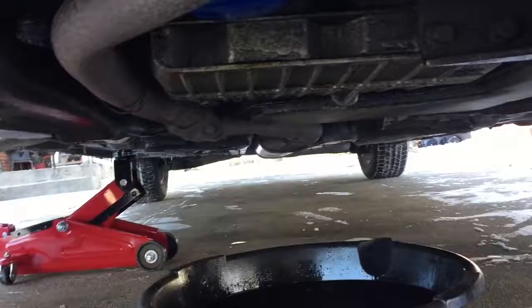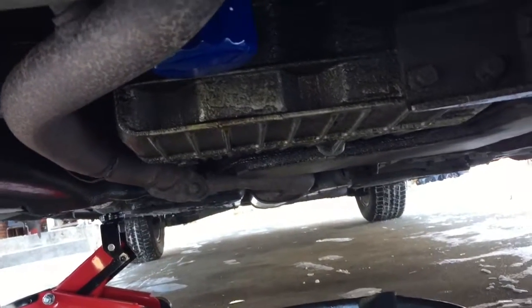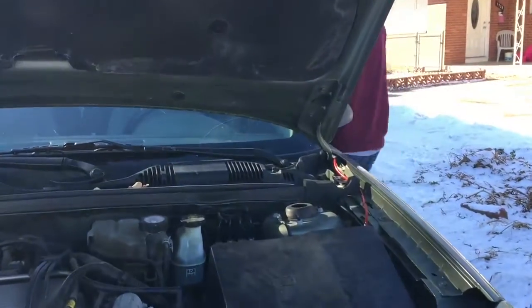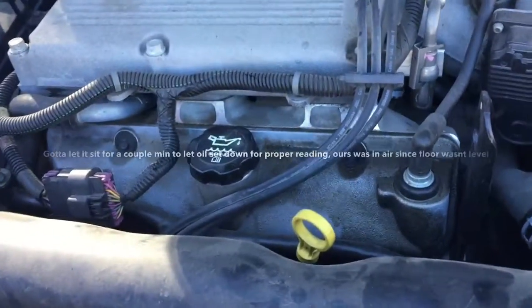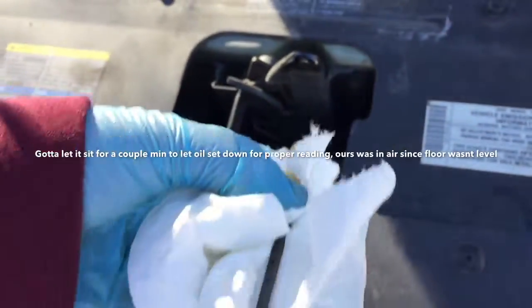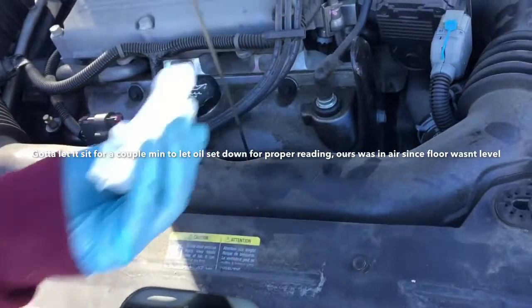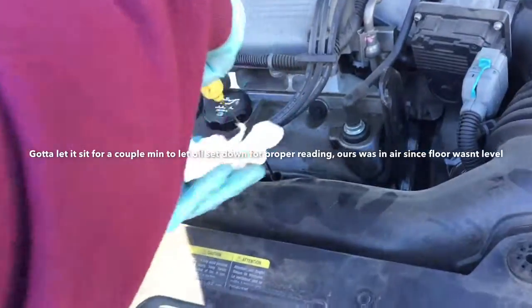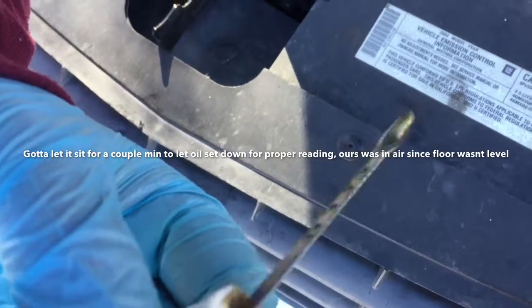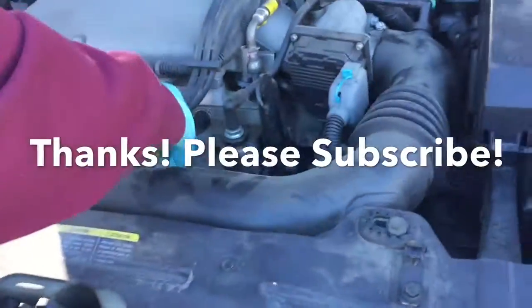It looks like there are no leaks — looks good. The filter looks really dry. And just like that, you've done your oil change. Pretty simple, pretty easy, and fast. Now you want to turn off the car and check the oil level. Take out the dipstick, clean it once, put it back in, bring it back out — and the fluid is good, perfect where it's supposed to be.